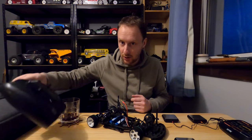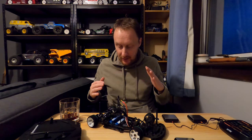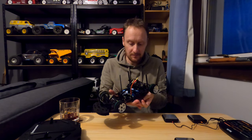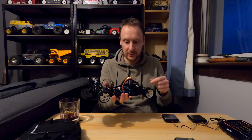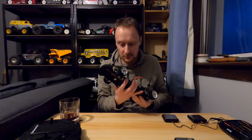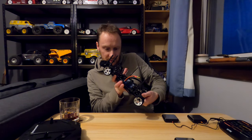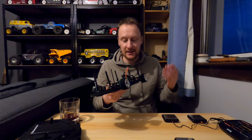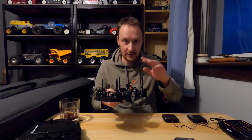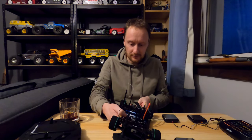I haven't at all tried this yet — no idea. I haven't switched it on, so I've got no idea if the motor is running in the right direction. I really hope it is, because unlike a sensorless brushless system, you can't just switch two cables over — you've got to reprogram it. And this speed controller, despite its cost — it's a Hobbywing Xerun XR10 Heavy Duty 4.1 — is very expensive and it didn't come with a programming card. I don't think you can reprogram it just using the button, so I'm really hoping this is going in the right direction. We will see.